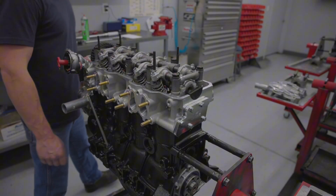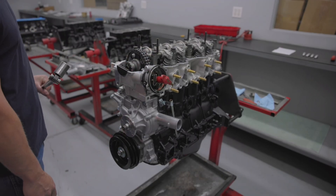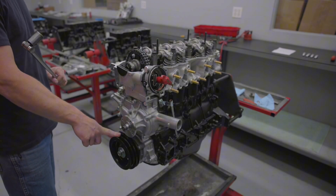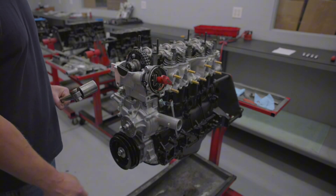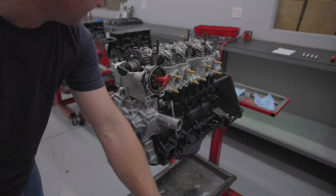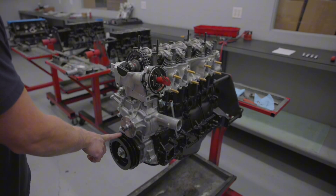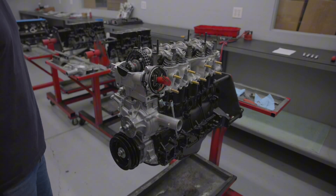That'll do it for the valve lash — we've got that all done. Don't forget to rotate your crankshaft back to top dead center, because we're not on top dead right now. Spin it 360 degrees until it comes back up, and your distributor rotor should be pointed back toward the 10 o'clock position where the number one spark plug wire was. Right at zero — marks are lined up, rotor's pointed at number one, the pin on the camshaft is pointed straight up. So we are back at number one TDC.